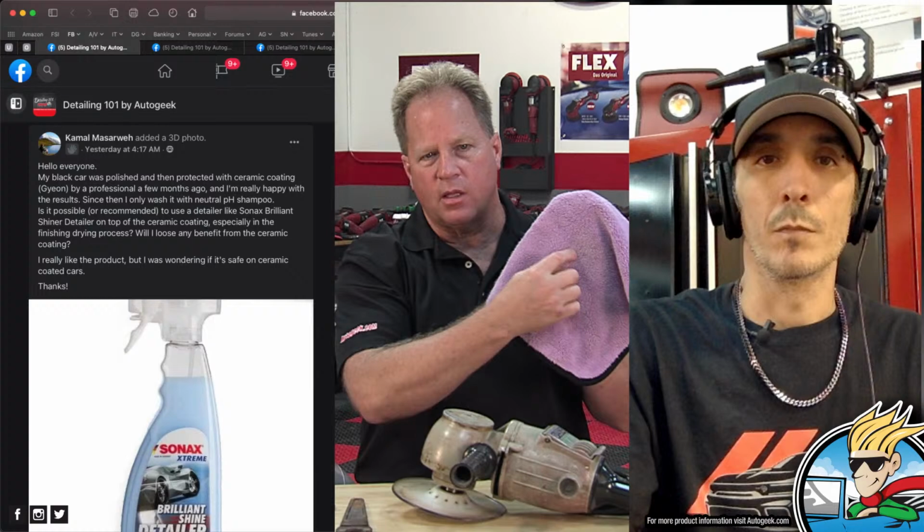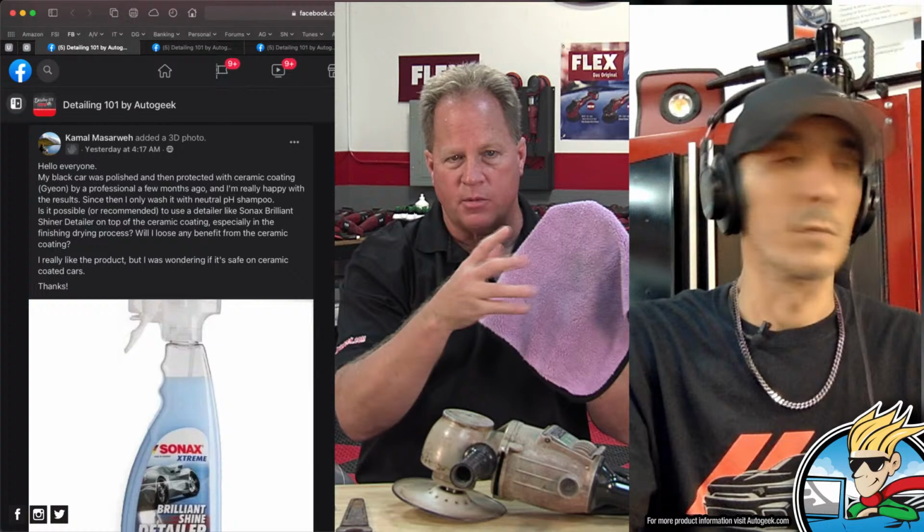The next most important thing is always make sure your towels are clean, soft, and uncontaminated. Anything with a nap can get contaminants in it. That's why you always want to feel them with your hand, because a lot of times your hand can feel contaminants that your eyes can't see. If there's a little contaminant embedded in there and you're drying that beautiful paint on your car, here's what I always tell people: it takes hours to buff out a car, and takes seconds to put scratches in.